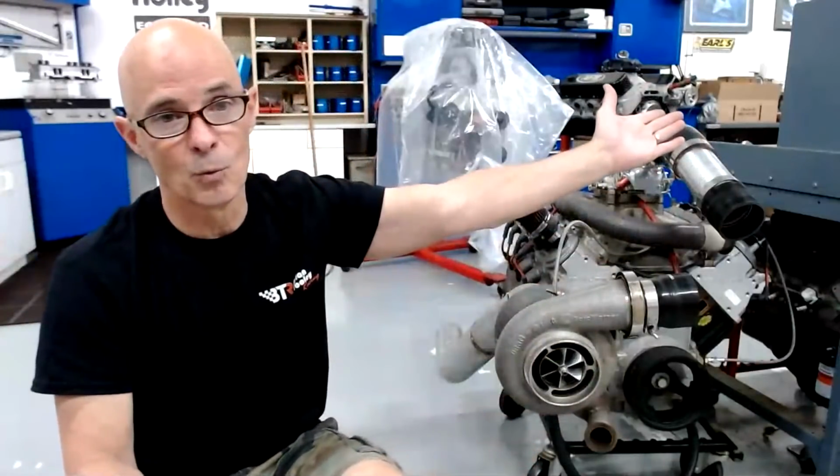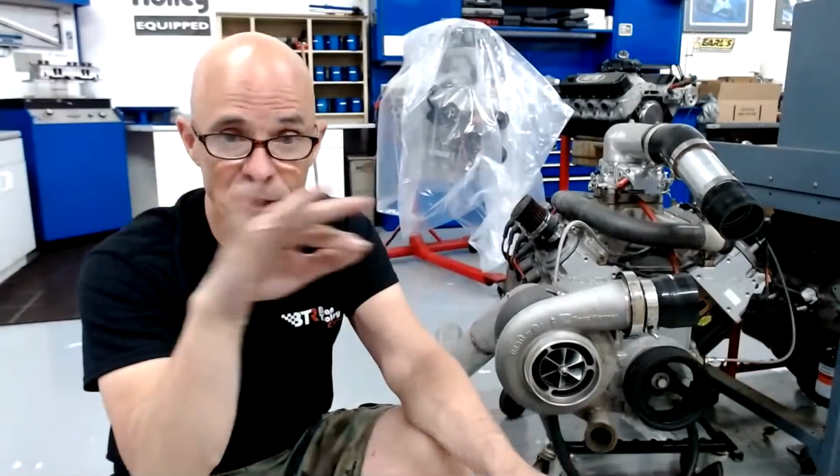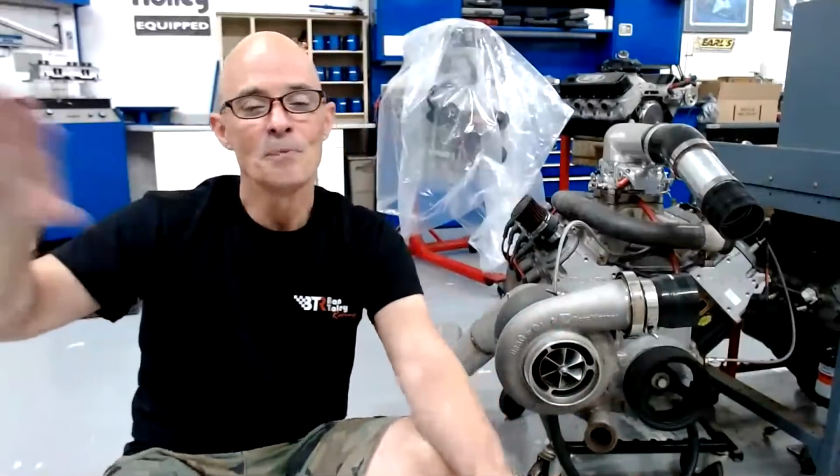If you take a look at what happened when we were running the 4200, where I was showing you in that video, and if you haven't taken a look at that video, you need to, where I was showing you that when we put heat in the turbo, it changed the response rate. And so it changed the effectiveness of the turbo. If you're not monitoring all that stuff and trying to exactly duplicate all of that stuff, your results may vary. And so let's say you're 5 or 6 horsepower off on one of them because of that. Maybe you let the thing idle longer. There are a lot of things to take into consideration when you're dyno testing.